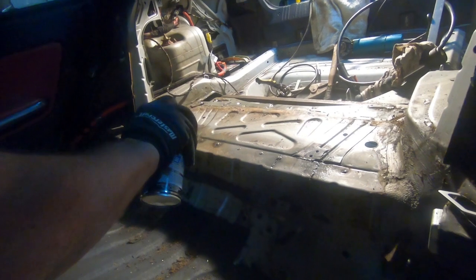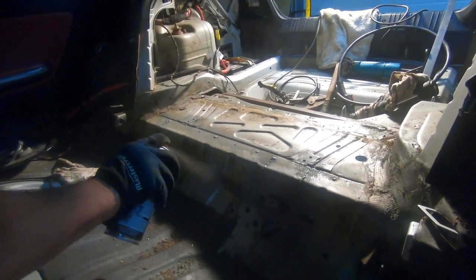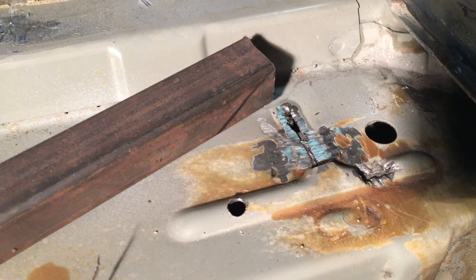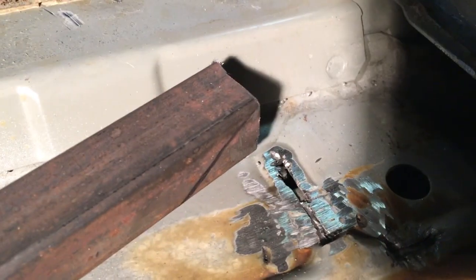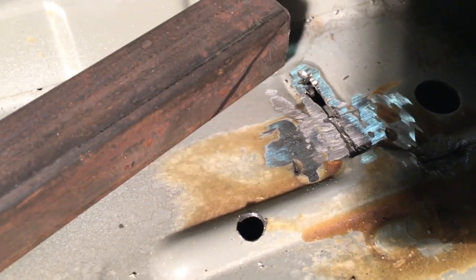The welds are thin but it's under the seat, under the floor — it doesn't matter. This is a rear upper subframe mount. I've done a bit of work to this side — compressed the groove and put a notch here. A little trick to get it nice and flush: grind a little bit off the top, then take a flat punch, put it in there, tap it down, turn it sideways to flatten it out, and it'll stitch it nice and neatly. That makes it really easy to lay a nice MIG weld bead in. Just touch up the factory welds on top a little bit too.